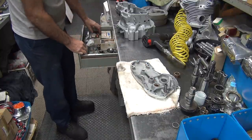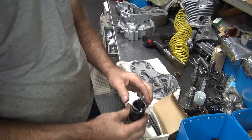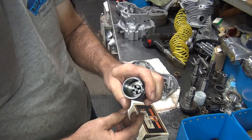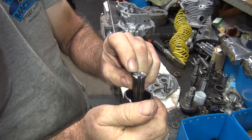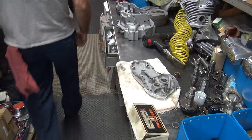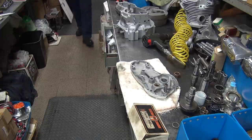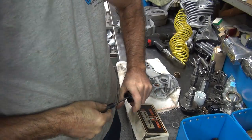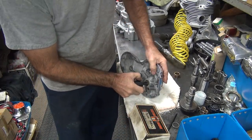Now I'm going to pull out this one right down here — pinion bushing pulling tool, Jim's again. It's been modified to make it work better. It's been cut deeper to give it room, notched over here for Sportster applications, and cut thinner through here so it'll fit in the cam cover on a generator motor. This is made for a cone motor. Once again, you make it work. Same deal — it collapses when you go in. Pops in there barely. Put your pin in there.